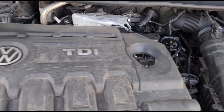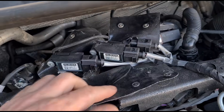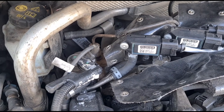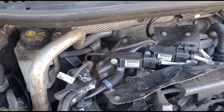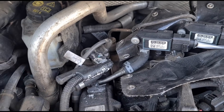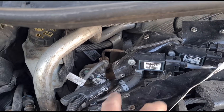We've just removed the engine cover. Behind this little heat-shielded cover we're going to have two sensors. One goes to the EGR cooler and this one goes to the DPF. They're both the same sensor and apparently these have already been changed as well. We've got a little bit of AdBlue crystallization there — not going to worry about that right now. I'm going to remove this hose and remove the bolt from here.